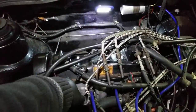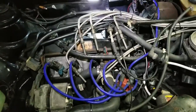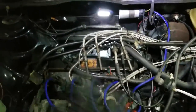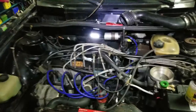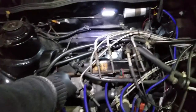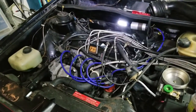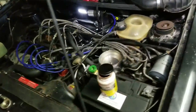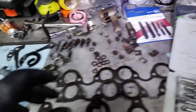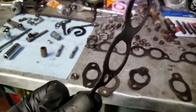What happens on these old cars is as oil leaks out from compromised, aged, or unreplaced valve cover gaskets, it slowly destroys everything rubber, plastic, gaskets, or fibrous materials like a clutch disc. I've had clutches fail on my old Mark Ones because of oil leaking from the valve cover gasket. You can use a two-liter ABA out of a '94 to '99 Jetta or Golf, but you'll have to change the studs out to ones without shoulders. As that valve cover gasket leaks, it takes out our intake manifold gaskets and they end up damaged, slowly leaking air.